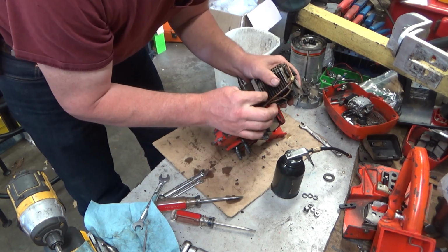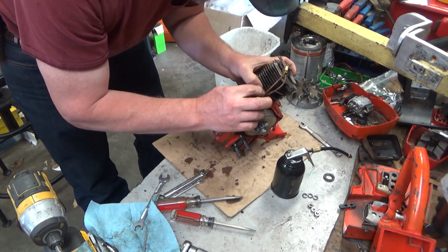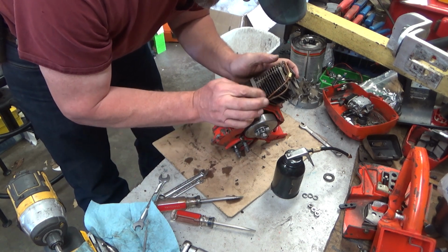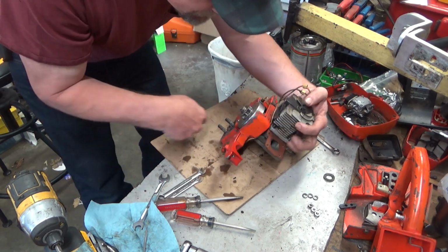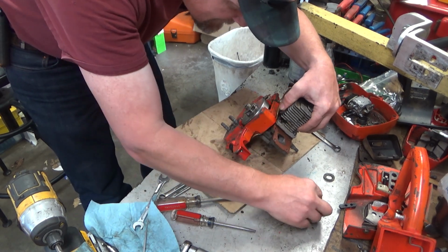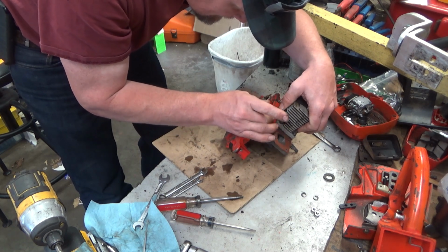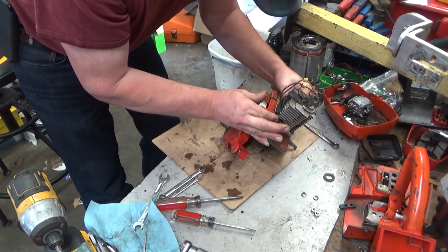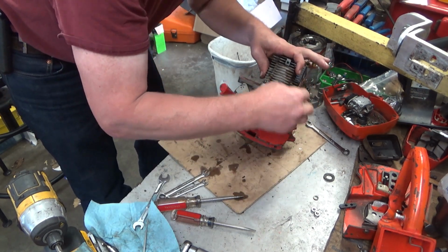Alright, so before you get too carried away, you want to get this side's nuts in place and started when you can still lift the cylinder a little bit. There's not quite enough room to get them in there when it's fully seated. Good news is going by feel there is not that difficult. I'll say this side is a slam dunk.